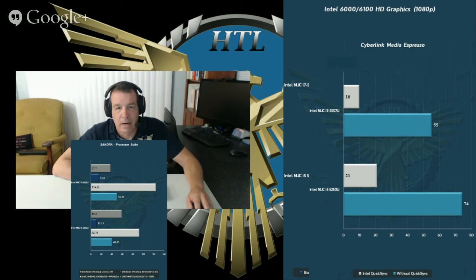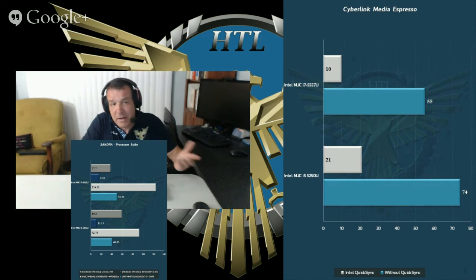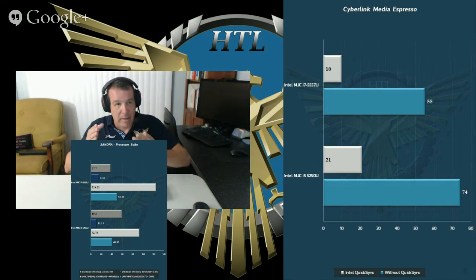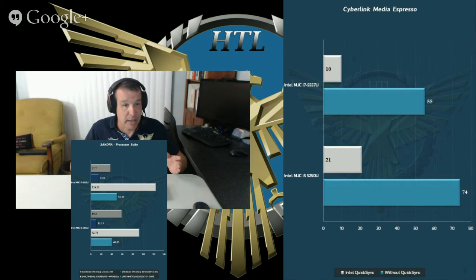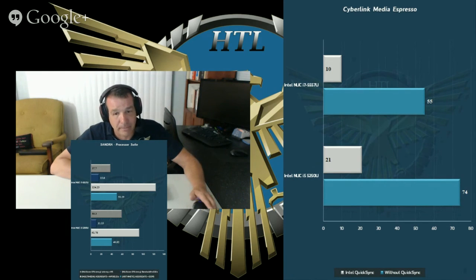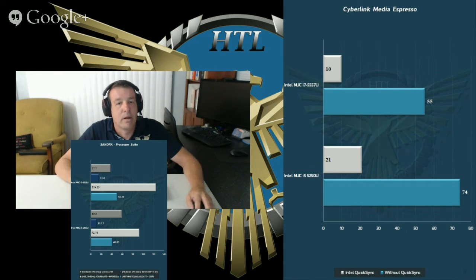All right, Cyberlink Media Espresso. Of course, this is transcoding. What I did was I took the same video, and if you don't believe me, you could go to our YouTube channel, look for the CES Gigabyte motherboard and Thunderbolt video, which is 6 minutes and 8 seconds. That's the actual video that I used to transcode. And now we can see some big differences here. Transcoding it without QuickSync. Now, of course, Intel is famous for their QuickSync, correct? Well, without QuickSync, no hardware acceleration, the Core i5 took 74 seconds, and the Core i7, 55.